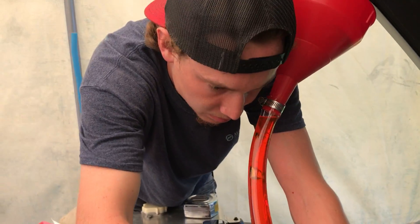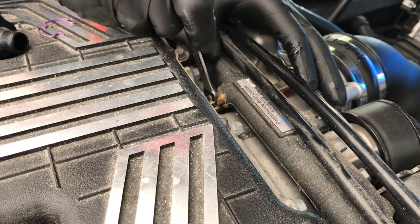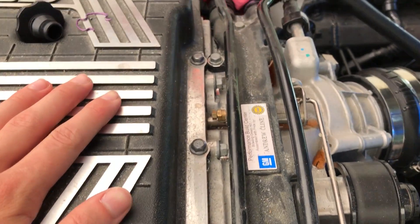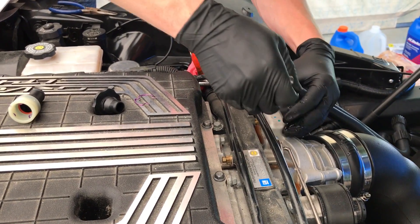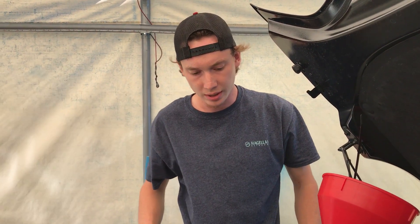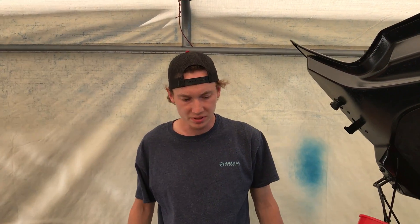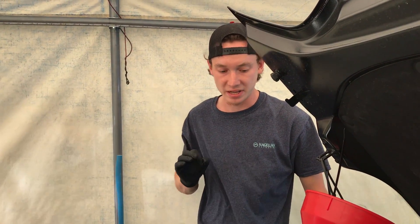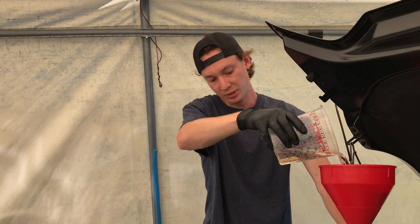This is how they bleed it - basically like bleeding brake lines. You bleed this one first because this is the inlet. Hey Andrew Klein, if you're watching the video, give us a little more information on how you put that supercharger together. It's going to take some time to get all the bubbles out, but we're definitely going to do that. We're probably going to order a vacuum piece we've seen online - that's the best way to do it, that's what the dealership and manufacturer use. We may even cruise up to the dealership later and get them to purge it for us.